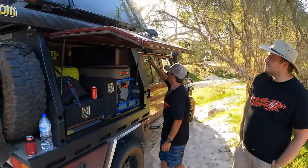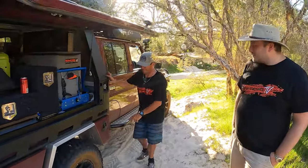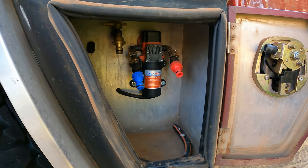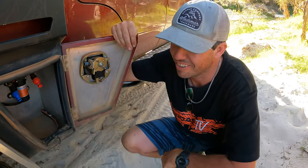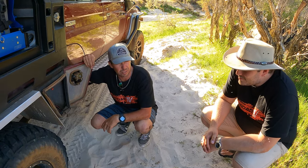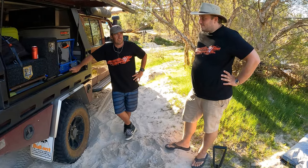I've got an awning, another one tucked in there, and a little shower tent by Pit Pitch that folds out into a little cube. The shower itself runs on a 12-volt pump: heat up a bucket of water on the fire, connect the hose, drop it in the bucket, and it pumps up to the showerhead. It does about three and a half to four litres a minute — pretty efficient. For water supply, I've got an 85-litre tank mounted underneath the tray.